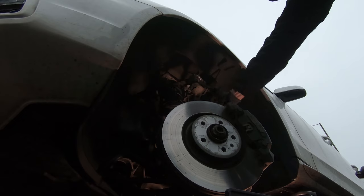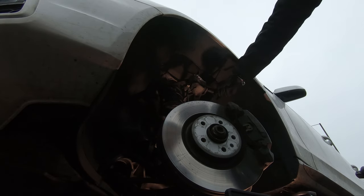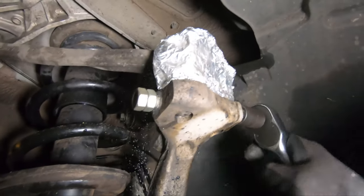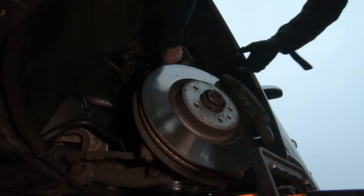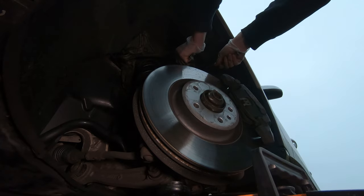After enough heat cycles, pressure, and time, you should be able to get the bolt spinning. If it can spin, it will be cleaning out a load of corrosion as you turn it, which is great. You should then be able to start unwinding it as the threads grip the aluminium and corrosion and push itself backwards. I would not recommend trying to unscrew it all the way — it's tempting, but on one side of my car it ended up getting stuck in a very unfortunate position. I'd highly recommend unscrewing it just enough to get the bolt head off the aluminium so there's enough space to get a pry bar behind it.